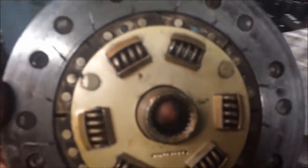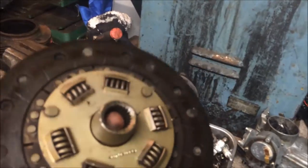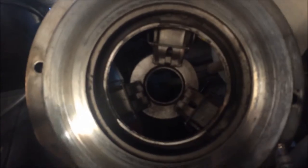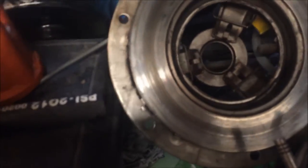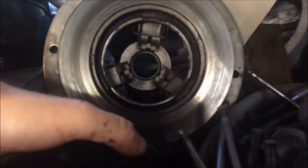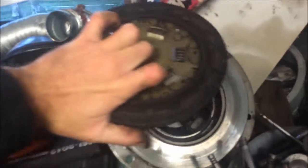There's the clutch. It seems to have got contaminated and shiny with the oil - it didn't look a bad clutch but you can buy replacement friction pressure plates and release bearings for them. The release bearing didn't seem that bad, it was only the friction plate. According to me, because the grooves aren't that bad, it would probably come up with some flat emery cloth on a piece of glass - there are no bad marks in it. A new friction disc is only £22, which isn't bad for an old car.